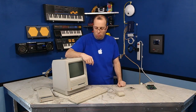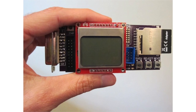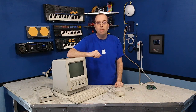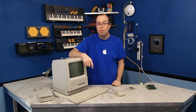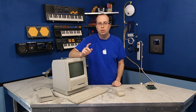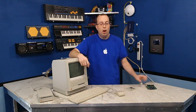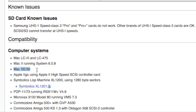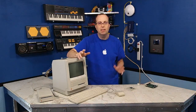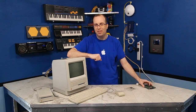There is another alternative — there's a product out there that will emulate a Macintosh floppy drive. One of the neat things about it is that besides copying a whole bunch of different disk images to the device, it can also emulate an external hard drive using the floppy port, since Apple actually did make some external hard drives that plugged into the floppy port. It wouldn't be as fast as an internal SCSI drive, but it would certainly work. According to the website for this product, it has been tested on the Macintosh SE30 — which is actually the compact Mac I've always wanted, the best black-and-white compact Mac they ever made. If I ever get my hands on an SE30, I'm going to put this inside it. As always, I hope you enjoyed this adventure — stick around because I've got more coming up.